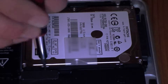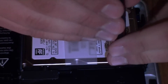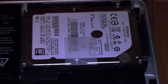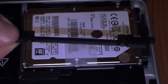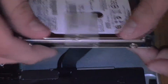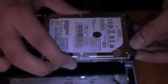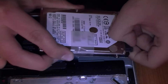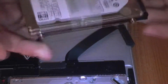Once the battery is disconnected from the motherboard, get out your screwdriver with the Phillips 000 bit and loosen the screws that are connected to the bracket. This bracket is holding down the hard drive, so you have to remove the bracket to get access to the hard drive. Once the bracket is off, slowly pull up on the tab that's attached to the hard drive and try pulling off the connector really slowly. You don't want to damage the ribbon cable that is attached, because if you damage that, your computer will be in trouble.